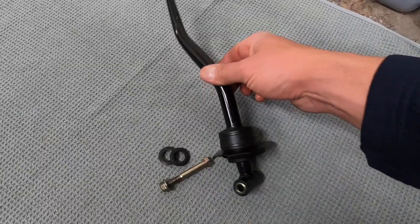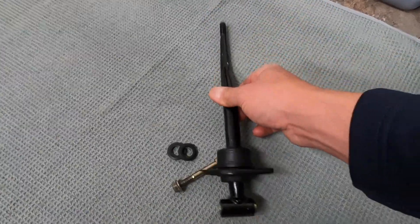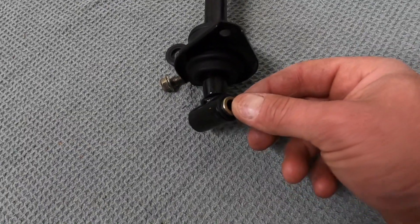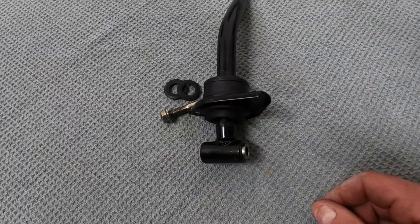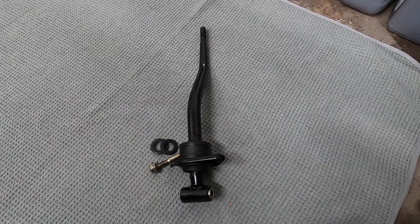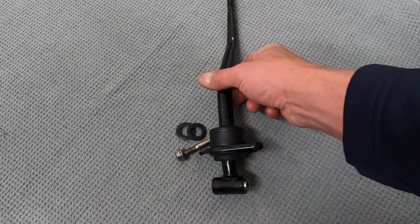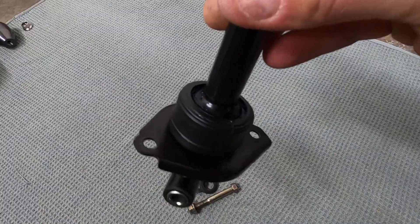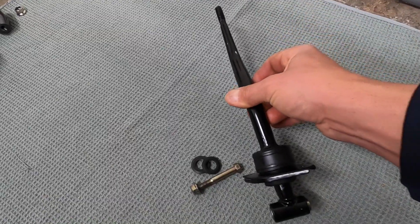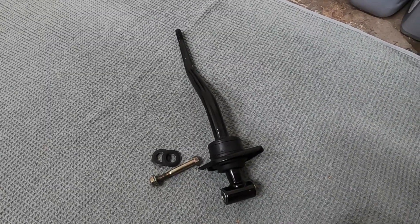Here's the stock shifter — I pulled it out of storage and spent a few minutes last night cleaning it. I pulled the plastic cage out and degreased it, soaked it along with the bushing. There are four O-rings that go on there — I cleaned and soaked them. I did not replace any of these parts, they all seem in good working condition. I degreased, cleaned, inspected, and then re-lubed everything with some high-temp grease in the cage and down in those bearings. It should work better than before.